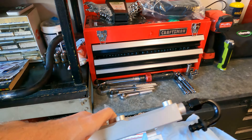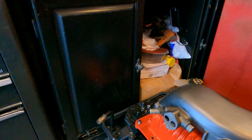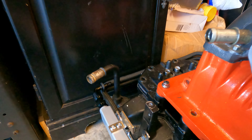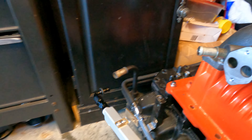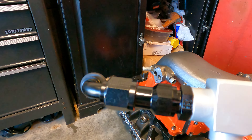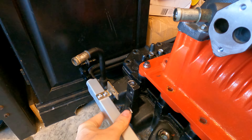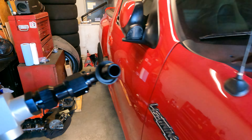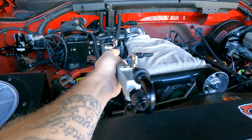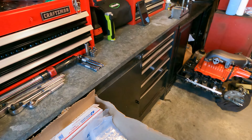In the last video, I went over an issue with clearance of the heater hose. This 90 was interfering with where the heater hose goes into the intake manifold. So I had to buy this straight fitting right there, and all that did was space the 90 out a little further. Now we have plenty of clearance — it easily goes around the heater hose. I even test fitted it on the actual truck to make sure it's going to clear everything, and everything clears. So that's resolved.